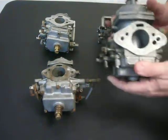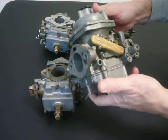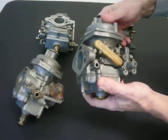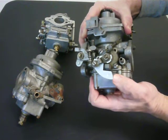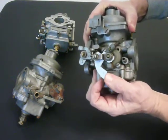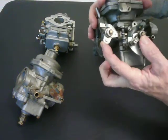When they came out with the CDSE, this is a more sophisticated carburetor made primarily for emissions requirements. One thing you'll see that's different along the side is a temperature compensator and a bypass valve. The cold start mechanism is not done via a starter bar like the older CDs, but a disc plate that allows different amounts of fuel to enrich the mixture for starting purposes, and it also opens the throttle slightly as well.